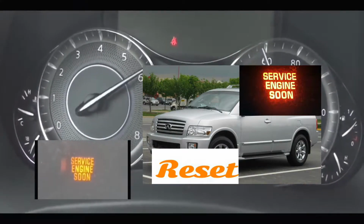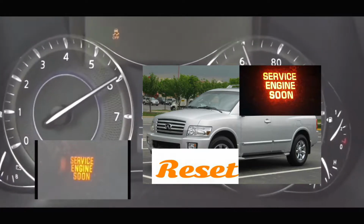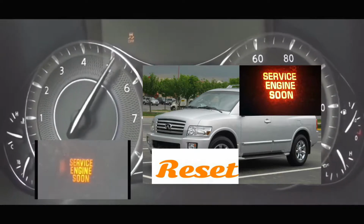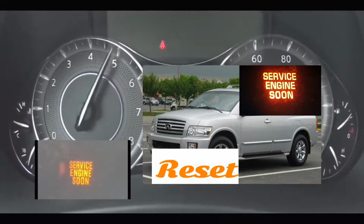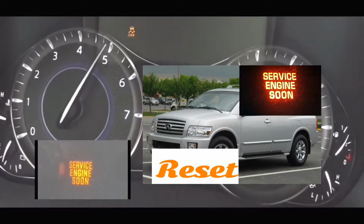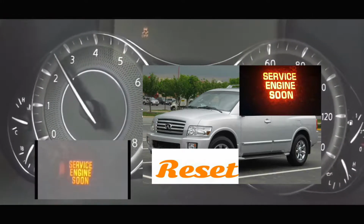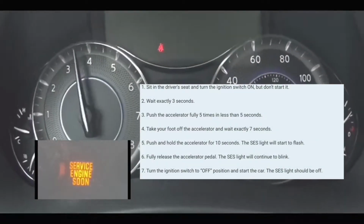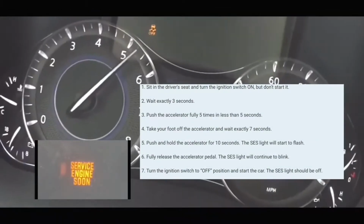In this video, we're gonna clear the service engine soon light off your dash. So what we're gonna do first is we're gonna have the car off. When it's off, you're gonna turn it on without turning on the engine. Turning it on means that all the lights on the dash are on, but the engine is not on, at which point you're gonna count to 3. You can count 3 seconds.